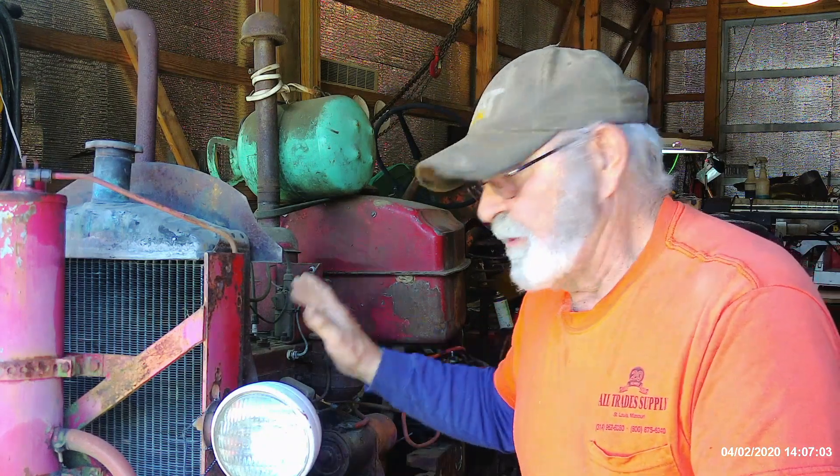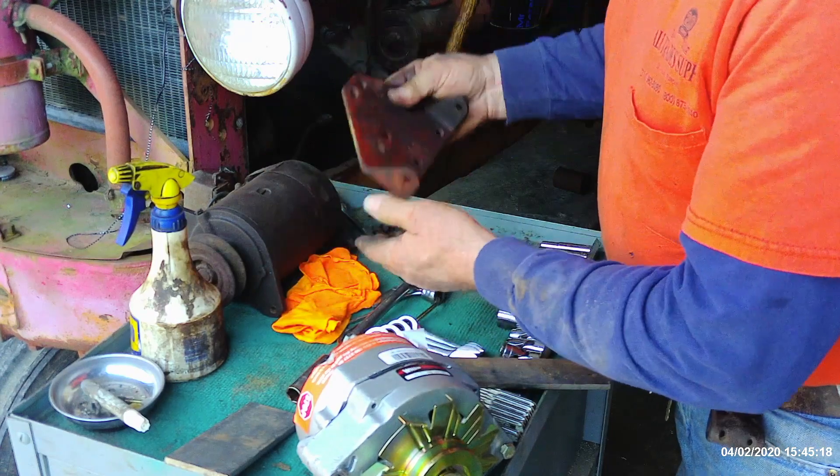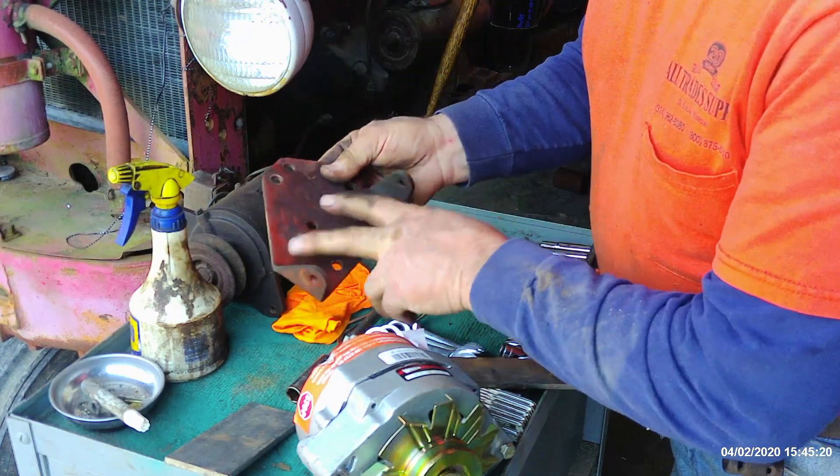You have to adjust the size of the pulley to make sure your engine RPM will spin this enough to get output. That's an easy test to perform: check your static voltage to ground off the battery terminal when you turn the key on, then as soon as you start it you should see that static voltage stay about the same. Once you elevate the RPM to the point this becomes excited, your output voltage on the battery terminal will go to 14.5 volts if your alternator is producing.